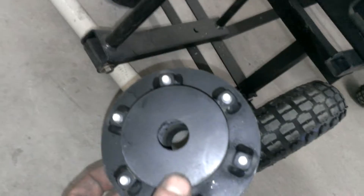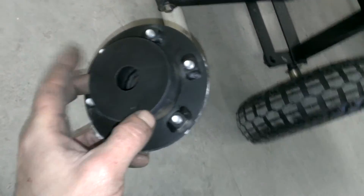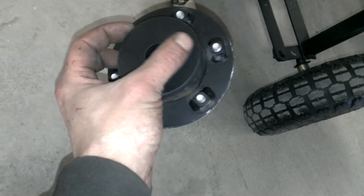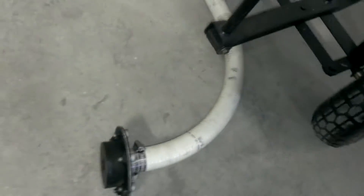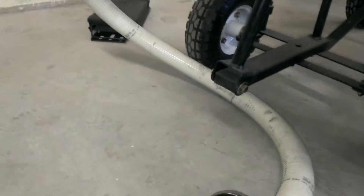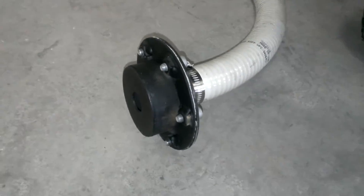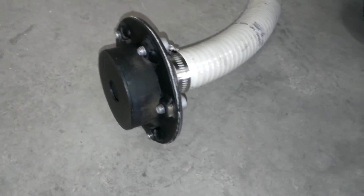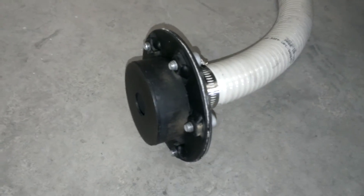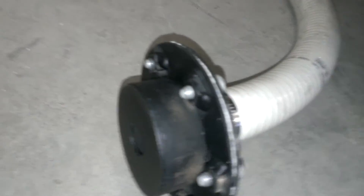This is our supplied manifold for attaching this to your engine. We already supply this with the center hole in the manifold, but you will have to punch a couple holes into this to adapt it to your carburetor. You want to put some kind of seal against this to create an airtight seal so you're not sucking in air. You may also want to punch like a 1/8 inch or 1/16 inch hole at the bottom side to drain any moisture that drops out there — this will keep it from filling up and getting sucked into your engine. The back pressure of the engine will shoot any moisture out through the bottom.